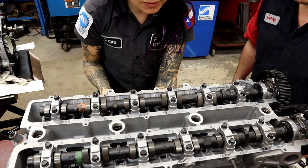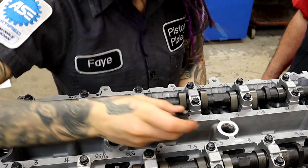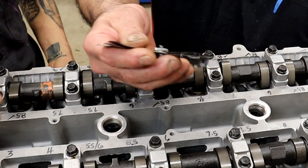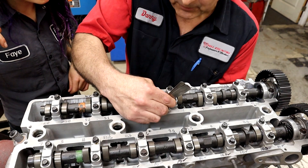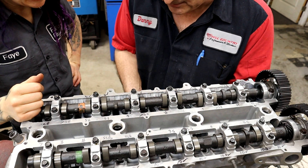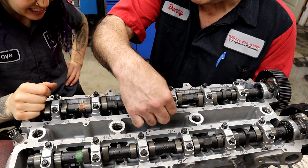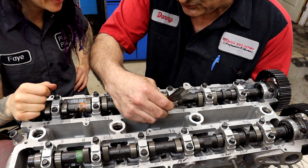Back to number six — I'm going to go for gold. I'll put six thousandths in there and see. I feel like it's really good — check it because it still rotates a little bit. And that's our eight. So at this point I get the eight and it's really close — maybe a half thousandths. So we're right at about seven and a half, just needing a half a thousandth. We're right there. So in this same instance, we only need a half — we could leave it there, but let's start off. What number was this one? One and a half.